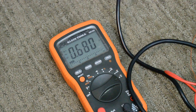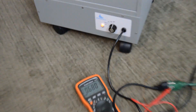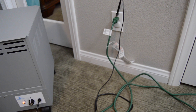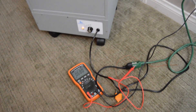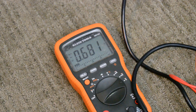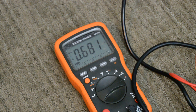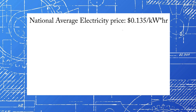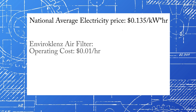For the next experiment, I tested the power consumption of the air filter. I measured the current draw from the filter and got about 0.7 amps. Multiplied by 120 volts AC and assuming a power factor of 0.8 to 0.9, which is typical for AC motors, you get a power consumption of about 65 to 75 watts — only a little higher than an incandescent light bulb. This was on the high setting, so that's as much power as this filter will basically ever consume. The national average price for electricity is about 13.5 cents per kilowatt hour, making this filter cost about 1 cent per hour, or about $7.50 a month to operate. That's a pretty small price to pay for clean air, and I was very surprised to find that it consumed so little power.